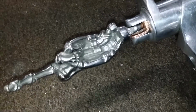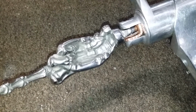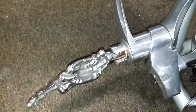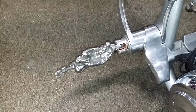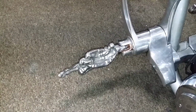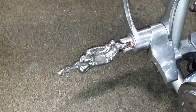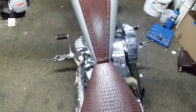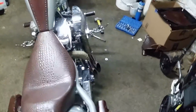And I also made a rawhide gasket, a leather gasket. And as you see, I also diamond cut the copper bracket. So that's what you have to do in order to put aftermarket foot pegs on this motorcycle, on this big dog. But it does work, and it is cool as hell looking. And as you see, I've already scratched my leg on those things too.